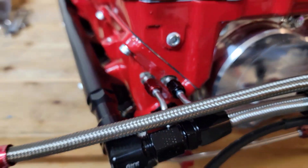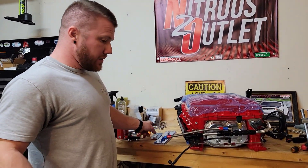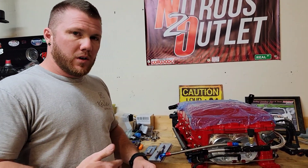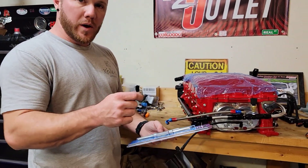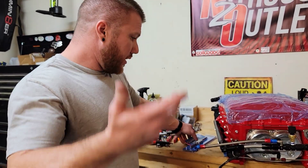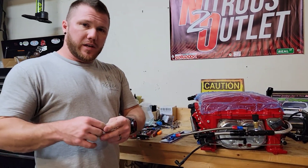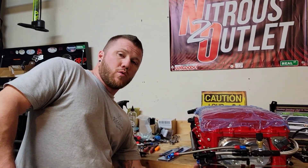What you'll have to do is buy this tapping kit and take your time. It's nerve-wracking anytime you're drilling into a brand new supercharger — I've never done that before. It did take me a minute to get through the metal. When you go to O'Reilly and pick these up, in the same section there's a cutting oil which helps keep the aluminum cool as you're drilling through it. I put the screw through using blue Loctite, which should help seal it because it is actually going through the runner.